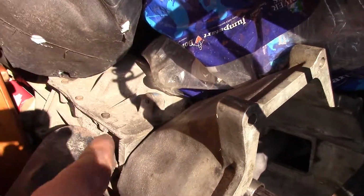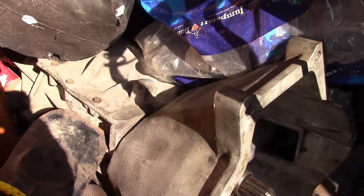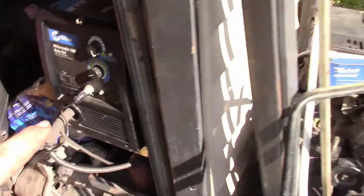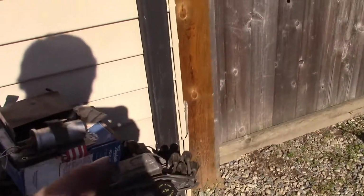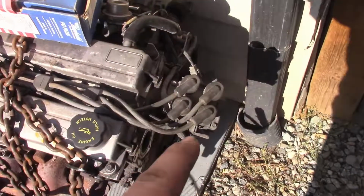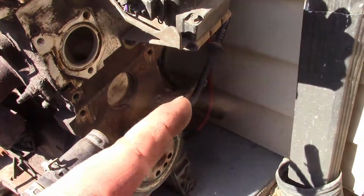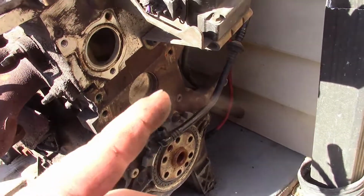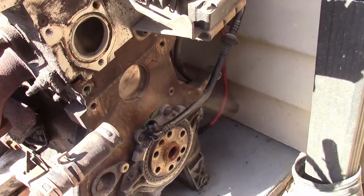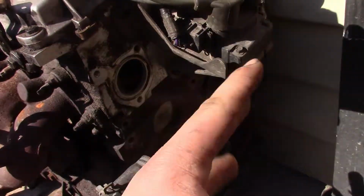I like the V6 transmission because it has a slightly taller first gear. The four cylinder ones are geared a little bit too low in my opinion. But this, with a, what's it out of? An '88 Turbo Thunderbird 2.3, the clutch disc matches the splines on that transmission. It's 9.5 inch diameter, which is more or less the same diameter as a Focus. I'm going to use a Focus flywheel and a Focus pressure plate with that clutch disc I have somewhere. It's around somewhere.